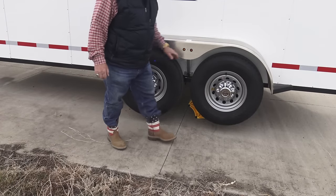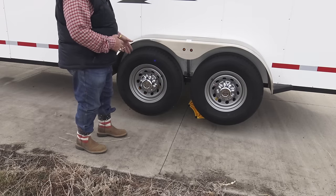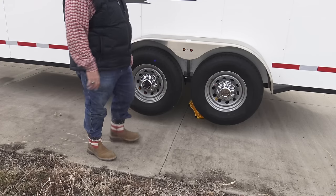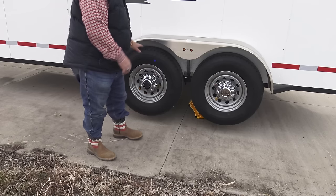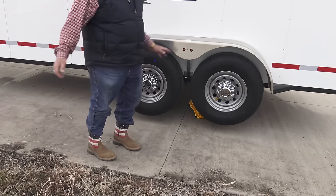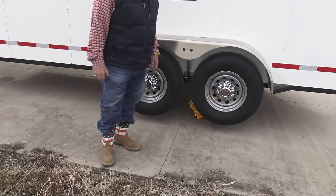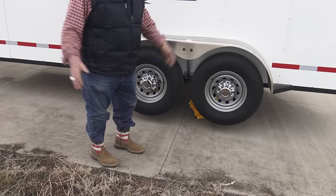Is that awesome or what? Just packed right up the whole trailer — went off the ground. Now I can grease bearings, I can roll wheels, I can inspect the tires, see if there's any stickers or nails in them. It's hard to get them off the ground unless you take them off to look for nails. This way I can look for nails and all kinds of stuff. This is going to make your tires last longer. Keeping from dry rotting in the winter — keep the weight off the tires and off the bearings — this will make your tires last like 50% longer.